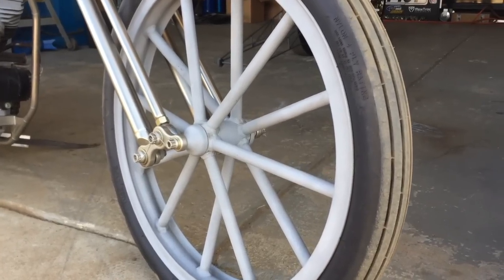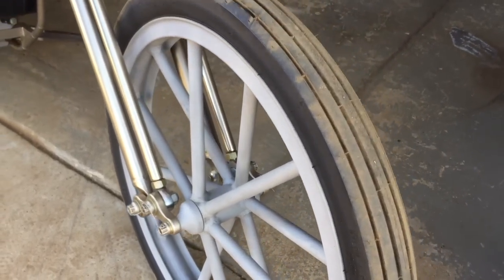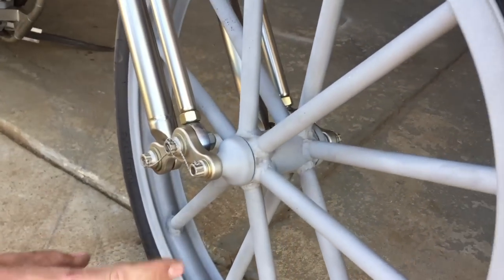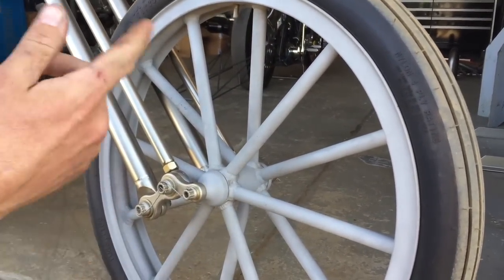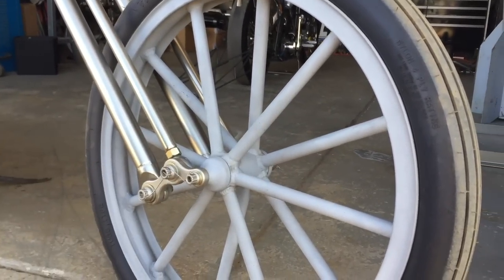What size of material is this wheel? That's a high-shoulder Akront hoop that I welded up and sanded all the nipples down. So this was a regular nipple spoke wheel — it had 36 spokes on it. I welded the holes, sanded them down, built the hub on the lathe, built the spacers on the lathe, jigged it up, welded it all together. It's all three-quarter, 0.120-wall 6061 spokes.